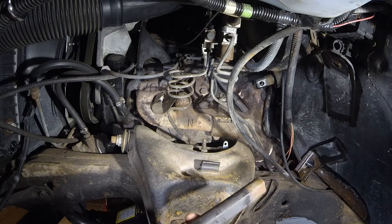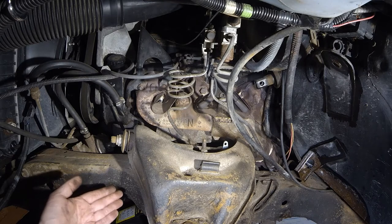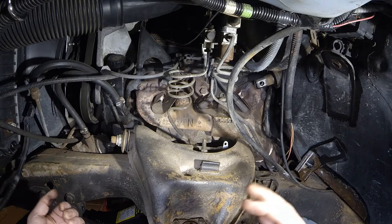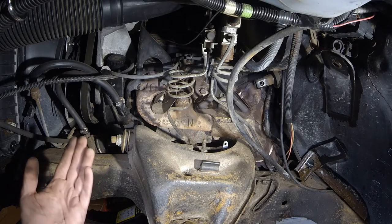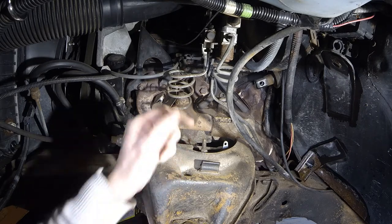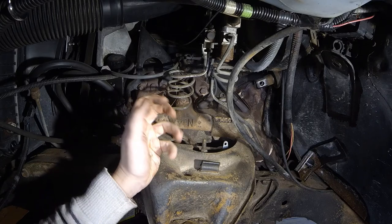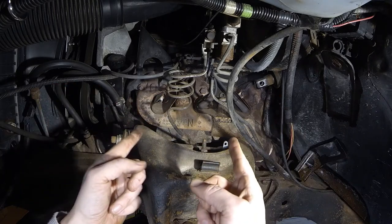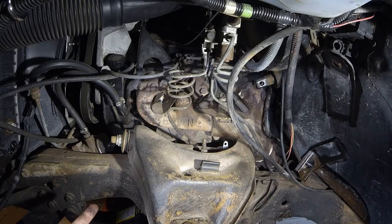So the only solution I have is to get a wheel realignment, and the tie rods — stuurstangen — need to be lengthened on one side and shortened on the other to correct the steering wheel position. So yeah, small project unfortunately doesn't really work as I'd like. Another thing learned. I'll reinstall the intermediate shaft and take it from there.